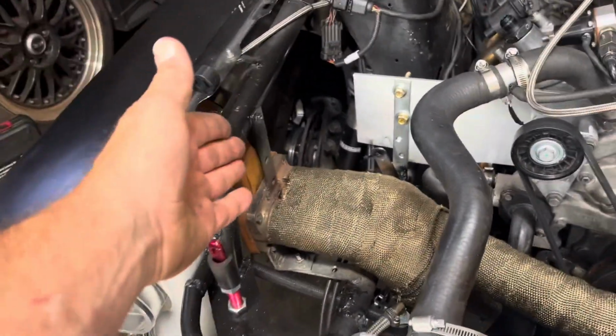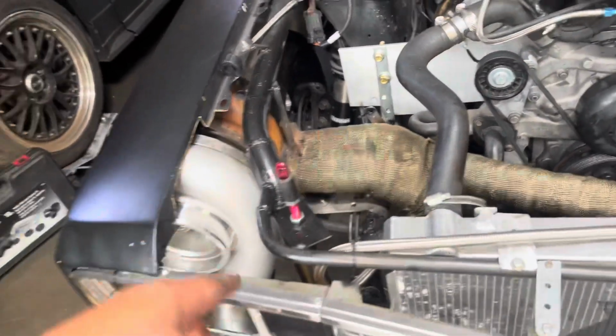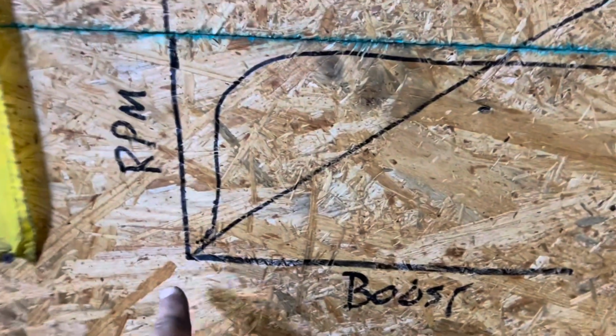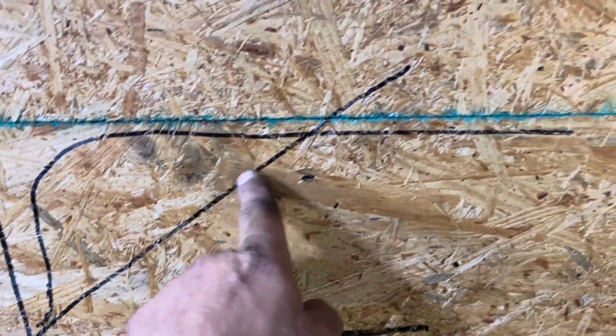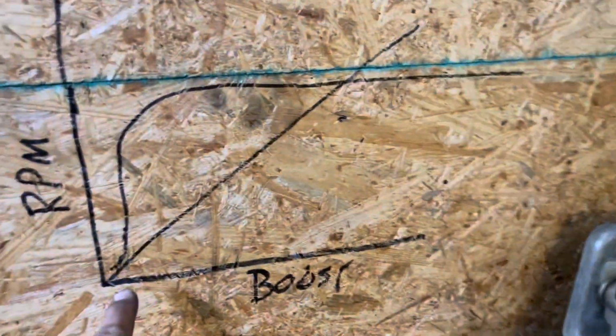Turbo, exhaust driven. See, no connection to the motor. Some people say it's free horsepower, some say it ain't. There's a horsepower cost right here in this housing, so we do affect it a little bit, but it's minuscule. Nowhere near what that would eat. But anyway, this one has a different boost curve. Procharger and most centrifugal superchargers are the same. They'll have a linear boost curve. Now it could bend up, come flat, but like I said, it only makes 7 psi on this motor. A turbo however will come in and ramp up, and we can maintain it. It won't persistently go up, so no matter the RPM, we can maintain. I said, Kevin, how the hell do you maintain? Things called wastegates, boys and girls, wastegates. They bleed off exhaust pressure. So I just give some of y'all newer guys that little lesson so you understand the difference.